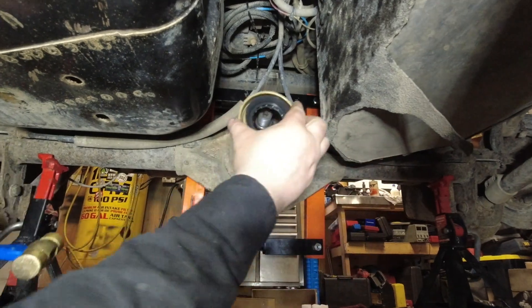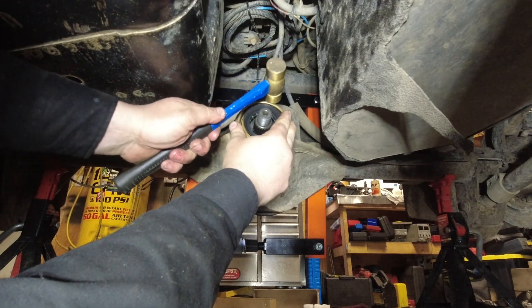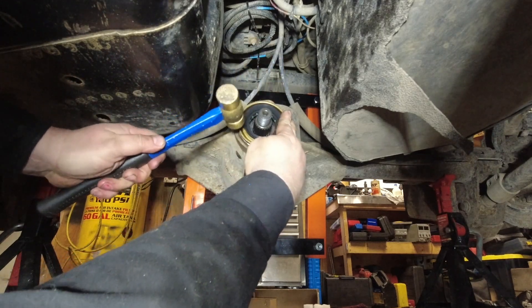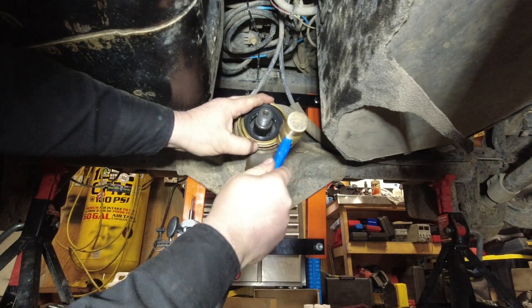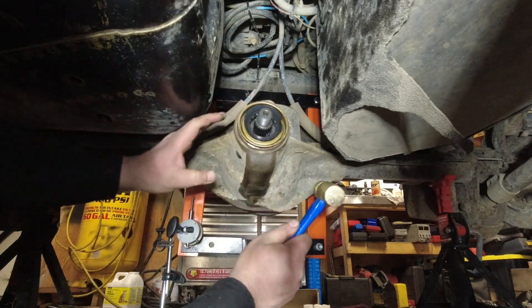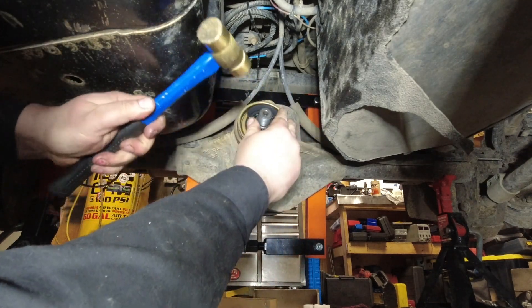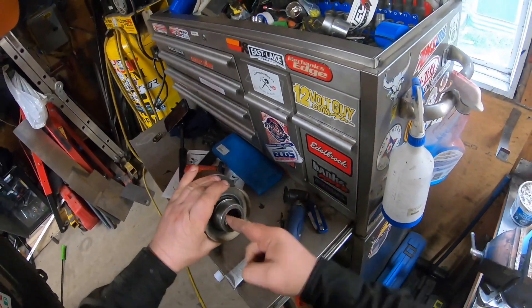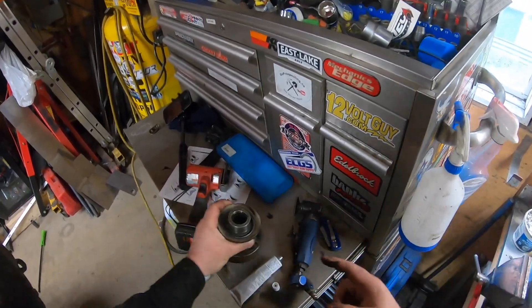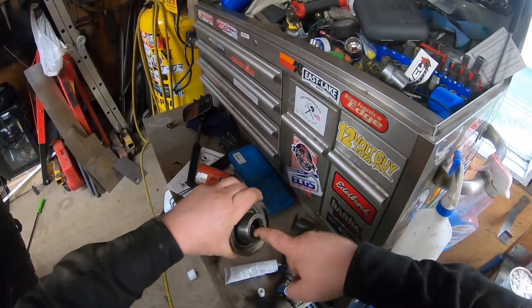What I'm doing right now is going underneath and just kind of putting the seal into place. I'm using a brass hammer and just lightly tapping the sides to get it set, then tapping a little bit harder, keeping working around the seal. You can also put a bigger object around there to tap it down. This is what I talked about before — you need the black RTV to put on the splines; this will prevent oil from seeping out and coming out the pinion.